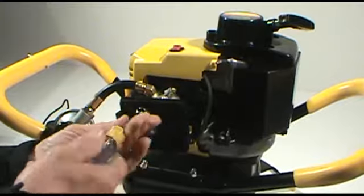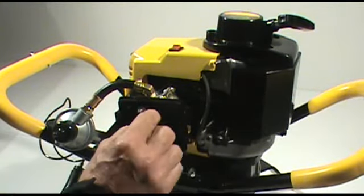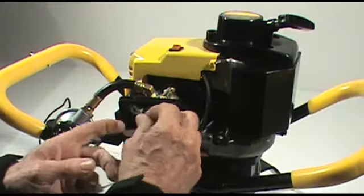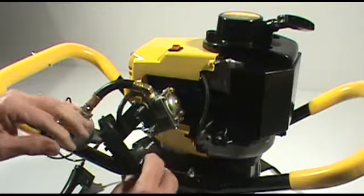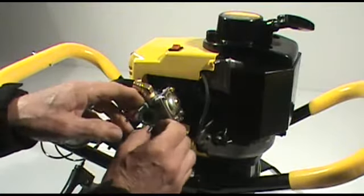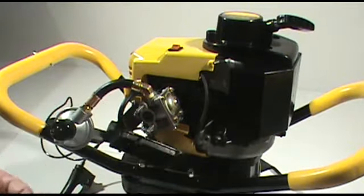Put the second nut off here. We'll go ahead and remove the backplate retention clamp, then slide the air cleaner backplate off. We'll then have to take off the gasket that goes between the air cleaner backplate and the carburetor.